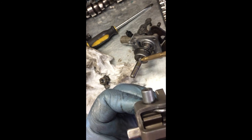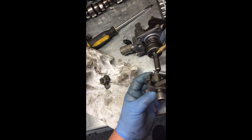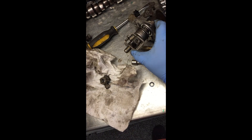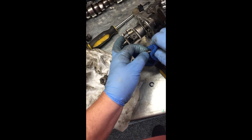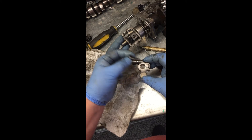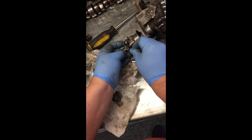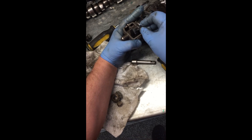In this little pin section of the selector, I push this down. The last two very important steps are this washer and this bolt — the bolt is actually a retaining pin that goes right through this piece here. Then the washer goes on. I'm using a little wave washer — a spring or lock washer — on the bolt, sticking it on the shaft, and I'll zip it down with the gun and torque it back up later.